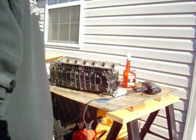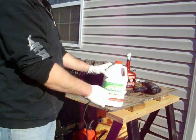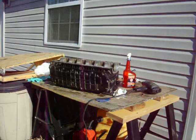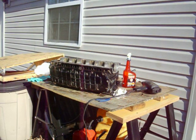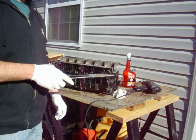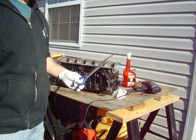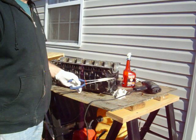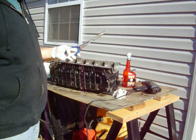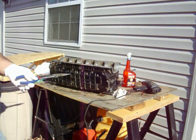What I had done — I didn't make a video on the whole thing — but I took some muriatic acid, it's like seven bucks at your local Walmart. I went down to Harbor Freight and bought a pair of throwaway long nose needle nose pliers, because the muriatic acid will eat these — it'll eat anything. I got some cotton balls and swabbed all the cylinders out. I took the cotton balls, dipped them in the muriatic acid, and swabbed the walls real lightly, making sure not to get any of the aluminum in the block soaked with the muriatic acid.